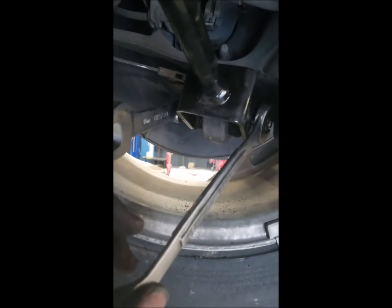For the lower end, I'm using the new Moog bolts — not reusing the Saab bolts. This one comes with an 18mm nut, so just get a crescent wrench on there to hold it, and then a 17mm bolt now with the Moog hardware. Putting two wrenches on there helps — working in both opposite directions. There's the 18mm on the nut and the 17mm on the bolt. Do the same for the other side, and once you're all done, just put the subframe back up.